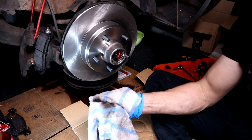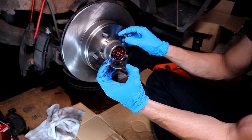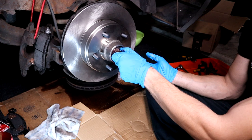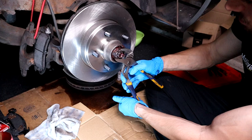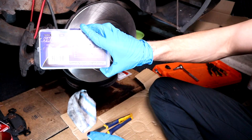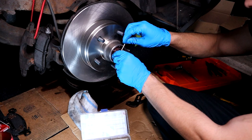Go ahead and wipe off the old hardware. Put in the locking washer and the nut. Now you want this to be able to spin freely without any movement. I'm going to go ahead and tighten the bolt all the way as much as I can just to pack the grease in. That was not moving all that freely, so I backed it up a little bit — and that is where it should be. Here are some cotter pins, also linked in the description down below. Make sure you put it through a hole that is not too tight and not too loose.